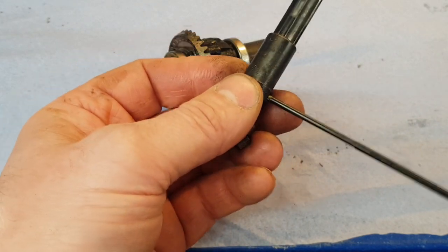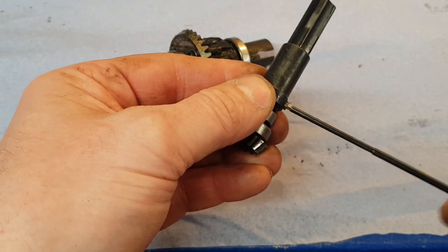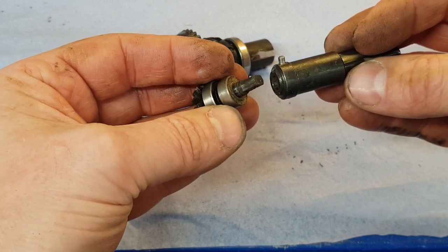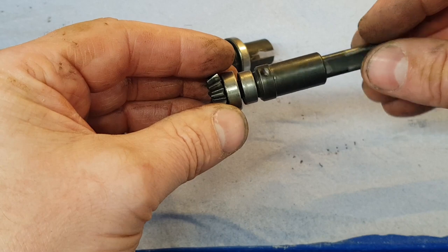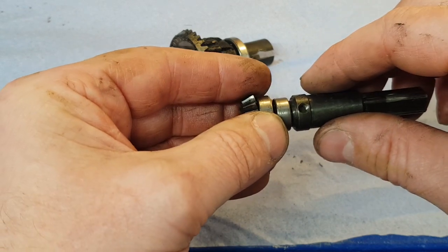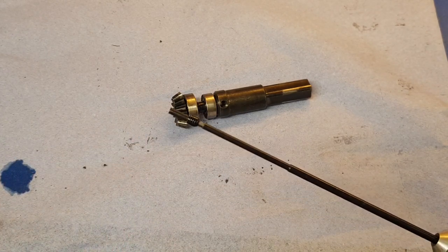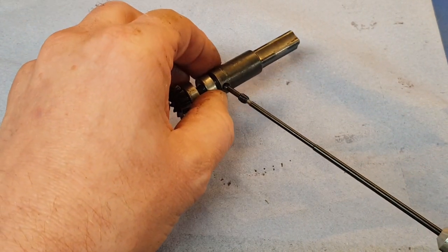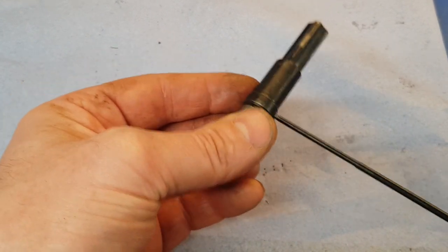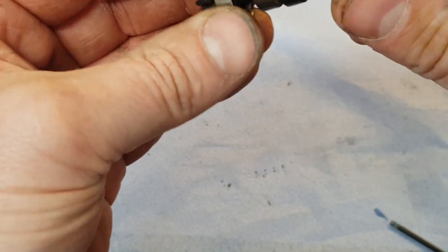It still doesn't feel quite right, so we'll take it to bits and see what's happened. That's not right — it looks like something snapped. Yes, you can see that pin has snapped. In actual fact, that was very soon going to be spinning freely and we wouldn't have had any front drive. We've got a spare pin so we can replace that easily. We'll just put a small amount of thread lock on it — always use blue thread lock, not red, because with red you'll never get the thing undone.